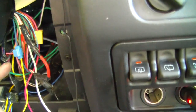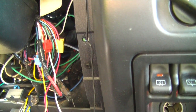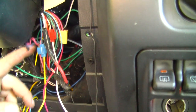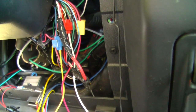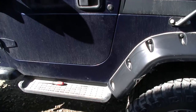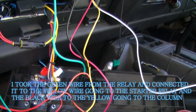I made a mistake installing the alarm. This pink and white wire had power when I was cranking and was 12 volts after crank, so I automatically assumed it was a starter relay wire, but it's not. Everything's pointing to a yellow wire — I didn't suspect it because it's thin, but it's the only yellow wire and it gets hot when cranking. So I'm gonna cut it and see what happens. Yeah, that small yellow wire is the one.